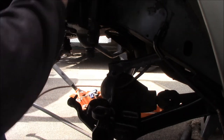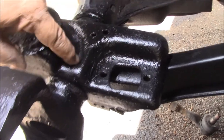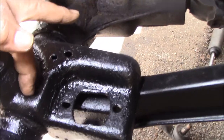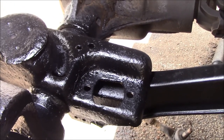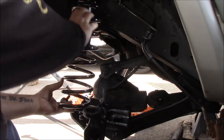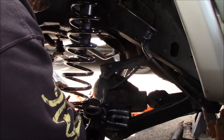Let me get some light on it. What I want to show you is the coil spring — you see this cut right here? This is where the coil spring end is going to go in. You bring that bottom coil right up to this opening, because that's what stops the spring from turning. That's where you want the end of that coil spring. When you put weight on it you can turn it back and forth, but once weight is on you're not going to turn it anymore. The second spring is usually not as easy because with the first spring in on that side, you don't have the same room.